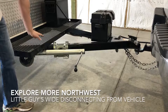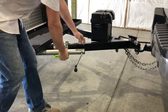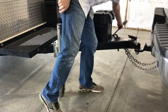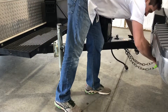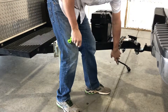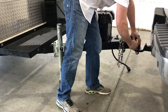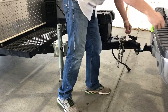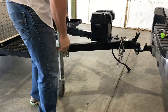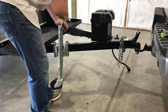Now we're going to go ahead and disconnect the trailer from your tow vehicle. To start, we're going to put down the jack. Now we'll disconnect the lights, then disconnect the chains from the tow vehicle — I like to fold those up so they're not dragging on the ground while you're camping. Then you can undo the padlock from the handle and set that on the bumper. Now you can lift the handle, and at this point we're going to lift the trailer up and remove the coupler from the ball on the back of the tow vehicle.